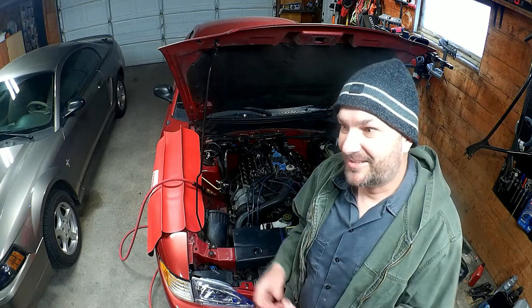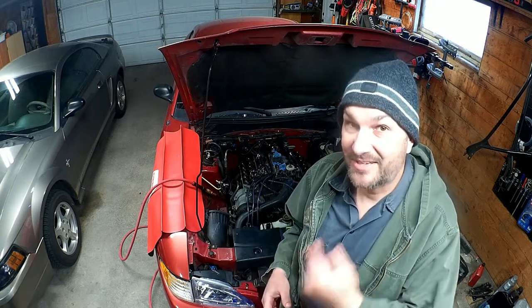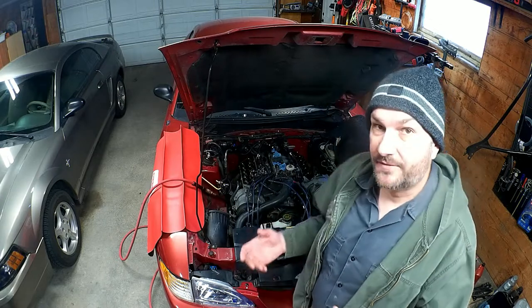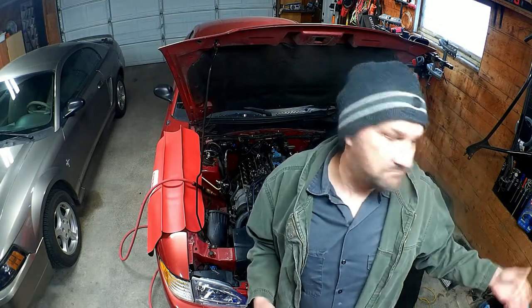If it's not enough, it's because you've got a real leaky cylinder and maybe you got some deeper engine problems than just this. So this should work just fine. The compressor is going to run probably 50% duty cycle while I do this. That's at least been my experience.